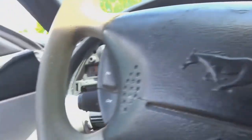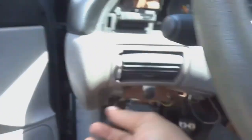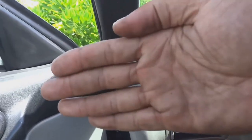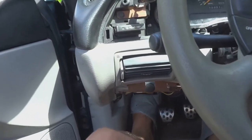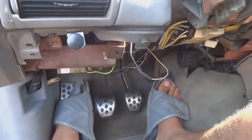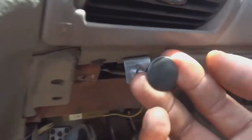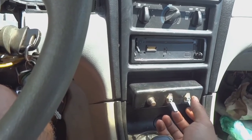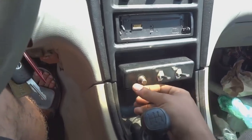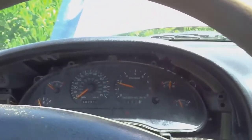The way that this works is that when you have it pushed all the way in, like it is now, it has the butterfly on the top wide open so that the air to fuel ratio mixture is changed. To close it, you have to first push your foot down three-quarters of the way and pull this out. Doesn't move very much, but it pulled out. And now, when you turn the key on, just wait for that beeping to stop. Turn on your spark, your fuel, let that catch up, and there you go.